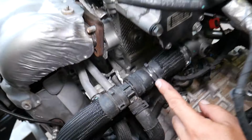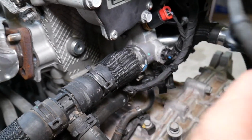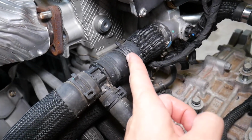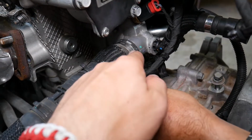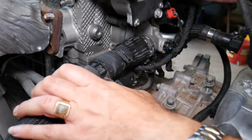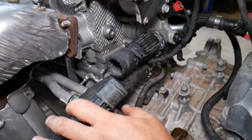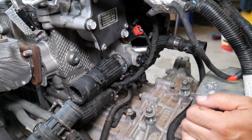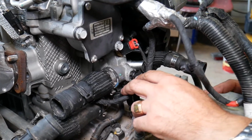After that, as you can see right here, those clamps are non-reusable, so you cannot reuse them again. You will have to go ahead and remove the thermostat housing hose from that one here. Or if you remove that clamp, you will need to install a new clamp. We'll have those in the description of the video below. Once you do that, you decide which way to go. If you replace the whole housing, you have to remove it from here. If you replace the thermostat only, you can remove it from here. I would recommend going with the whole housing. It comes with gaskets and everything, so it will be way more convenient.